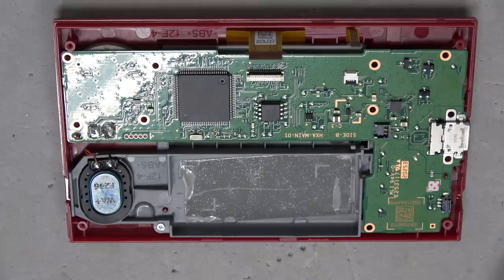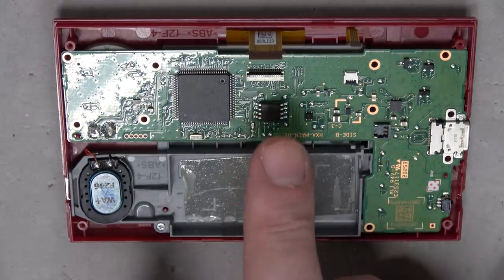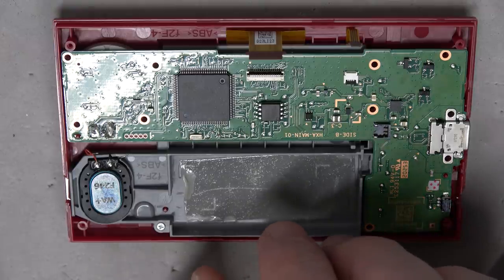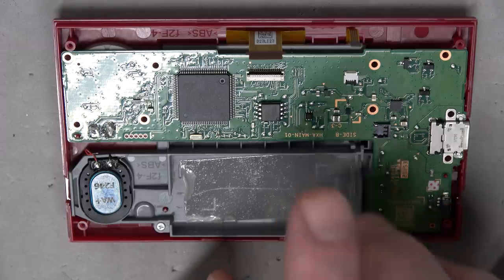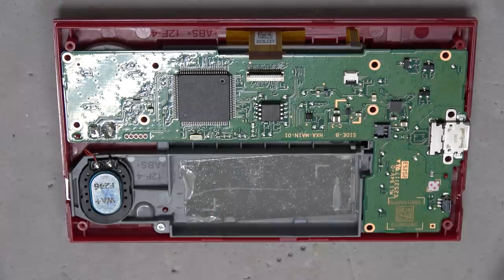JPEG hardware accelerator. Oh, wow, up to 35 communication interfaces, including FDCAN, USB 2.0, high-speed camera interface, parallel synchronous data input output, slave interface. Oh, it has an external memory 32-bit parallel interface. Wow, that's pretty cool. So you could actually attach parallel memory to this externally. The STM32H7B0 value line provides 128 kbytes of flash memory, 1.4 megabytes of SRAM with a scattered architecture. That's quite a bit for any microcontroller. Yeah, this is not a bad little chip.